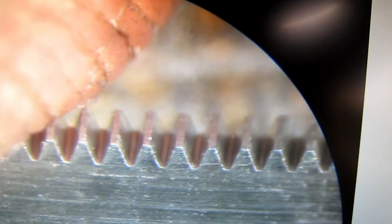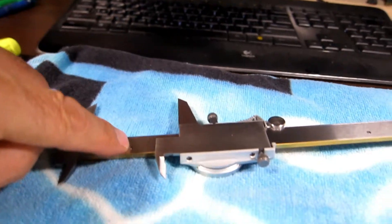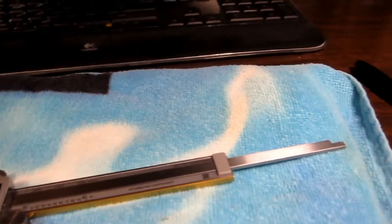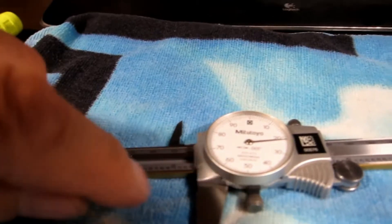So that rack has to come out. See how nice and pretty it is after it's cleaned. So you take the rack out — just get your drill and screwdrivers and take out the three screws. Take that whole thing off after you take that little plastic thing off. Take out the three screws, get the rack off of there. Clean it. Clean the body with WD-40, scrub it out, wipe it down.